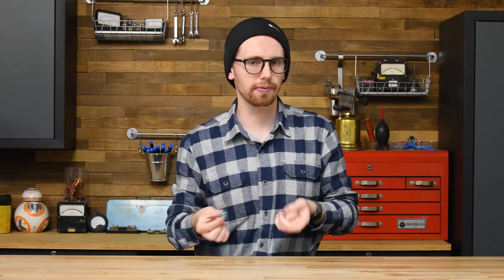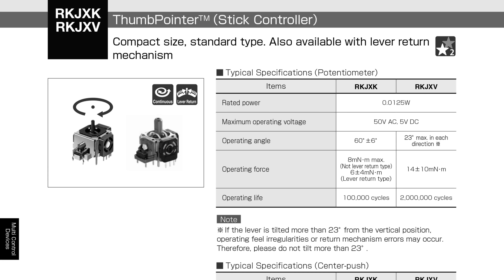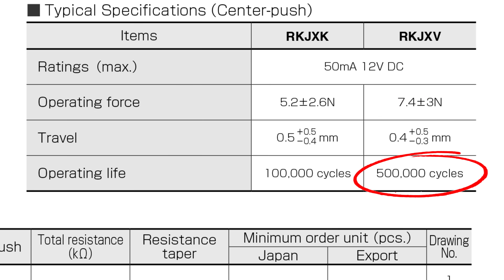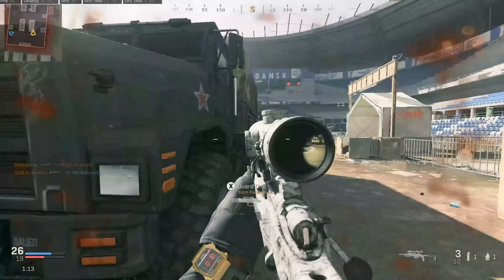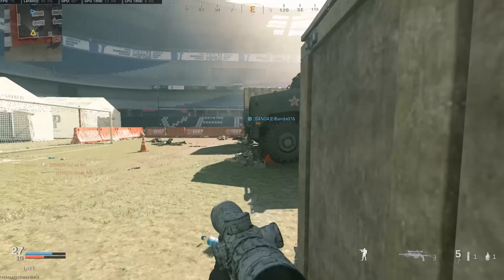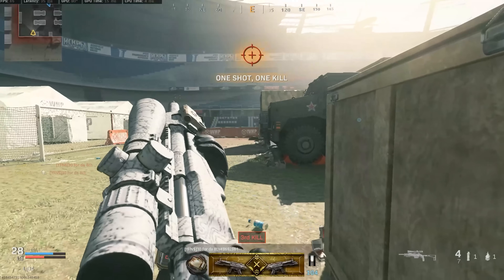Let's take a look at Alps' information sheet for the RKJXV, a familiar-looking joystick. Right on page one of the product sheet is the operating life for the RKJXV's potentiometers: two million cycles. Just below that, the lifespan for the center push function: 500,000 cycles. Some back-of-the-napkin math based on our co-workers' Call of Duty gameplay gave us a shockingly low number — the components in these sticks could easily exceed their operating life in just over 400 hours of game time.